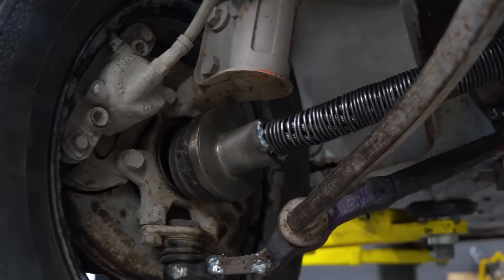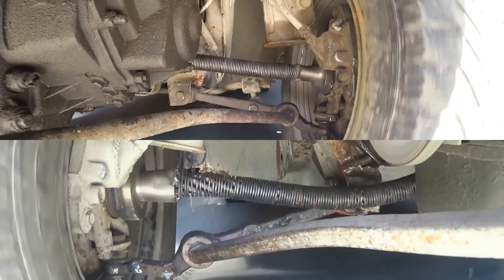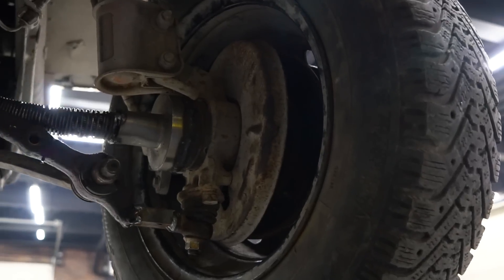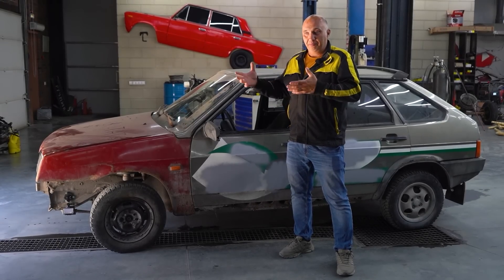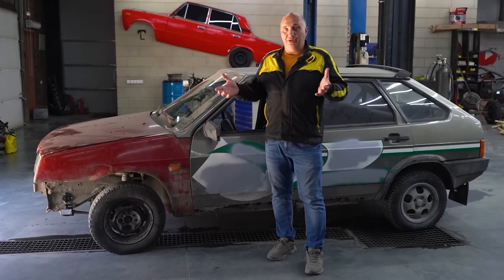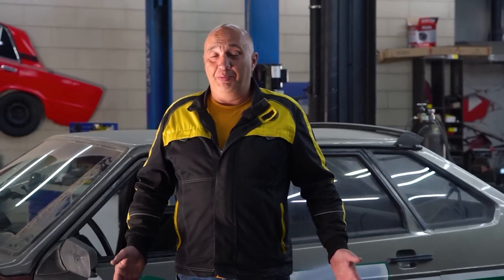I am genuinely disappointed. At the end of the day, these are under tremendous load, even despite the fact that I was being very gentle with them to try to ease the stress. Nonetheless, the side that would be prone to unraveling does so. We failed. At the very least, we've definitively proven that you cannot use wire rope to make flexible axle shafts. You could argue that cross-woven cables would have done better, but I've honestly never seen them in this diameter — a 26mm like the one we have. They worked up until a point, but we reached that point way too quickly. An experiment's an experiment — you saw it all with your own eyes, and that's all I got for you.